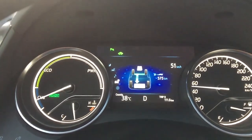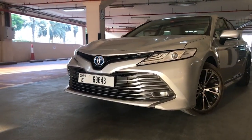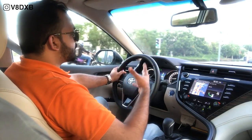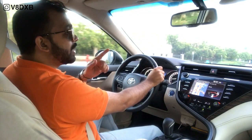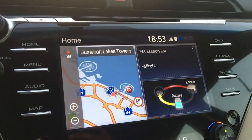One thing a lot of people have confusion about with a hybrid is: how do you charge this car? That is a big myth I'm trying to bust — this car does not need to be charged by plugging in overnight or into a wall socket. The car charges on two principles. One is regenerative braking: the moment you let go of the accelerator or press your brake, it starts charging, and you can see the charging display go up. The other way the battery is charged is using the engine power — there are times when the engine is driving the car and charging the battery at the same time.